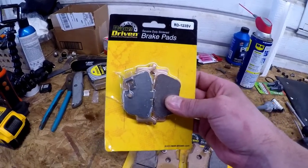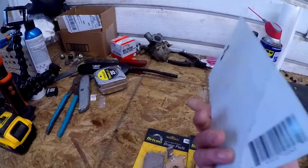I got these severe duty sintered brake pads here from Race Driven — not a sponsor, but pretty good price. I went back and forth between a heavy duty sintered pair or going with a set of brass brake pads. Brass brake pads, when you're in the mud constantly and you get all that grit in there, will last a long long time, however they don't have the stopping power your more traditional brake pads do. So I figured with the big 32s I'm throwing on here, I'm going to play it safe and go with a more traditional sintered pad instead of the brass ones, because I want to be able to stop. Plus we'll be able to compare and see how long these last — maybe once I go through a set of these I will try a set of the brass ones so we can do some comparisons.